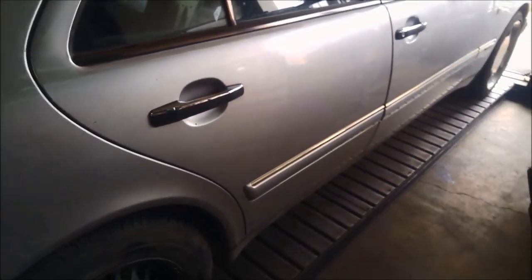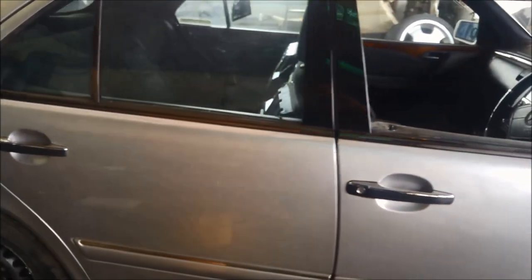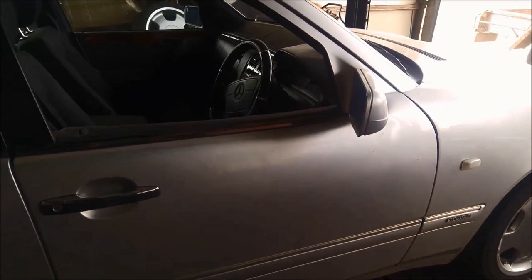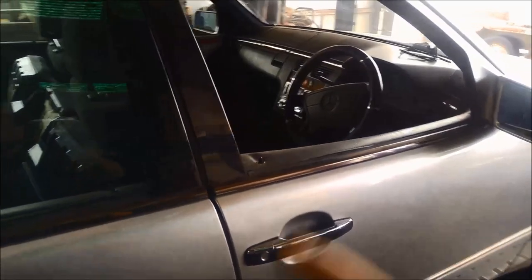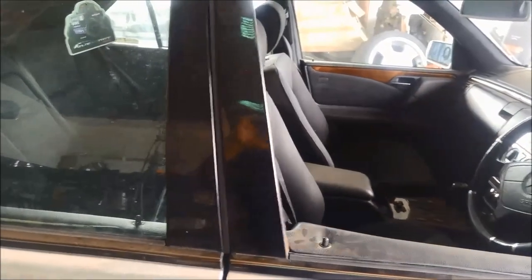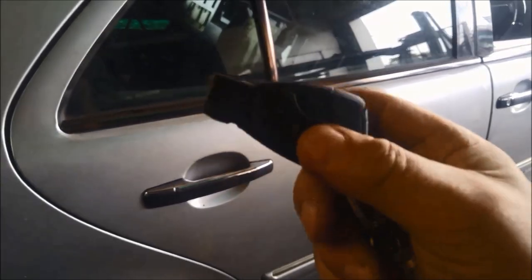Marvellous. Everything's working fine. I've been learning a little bit about this myself, find out what improvements I can do on it, but definitely that bi-metal thermo switch is a good idea. It'll just help it not overheat or burn out. The owner of this vehicle reckons that while they were driving it, the door locks were pulsating up and down, up and down, up and down. They didn't know what was going on, kept driving it until eventually it stopped. The doors stopped unlocked, and then they couldn't lock it anymore. Nothing would open, and they couldn't get the boot open. They had to get it open with the key.